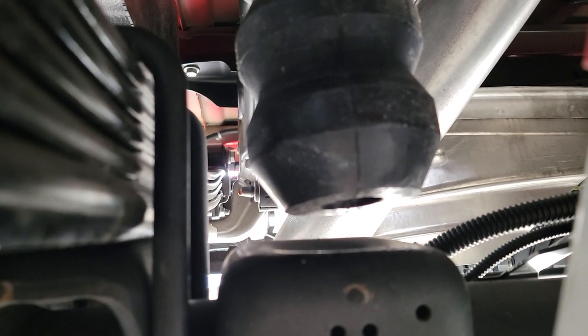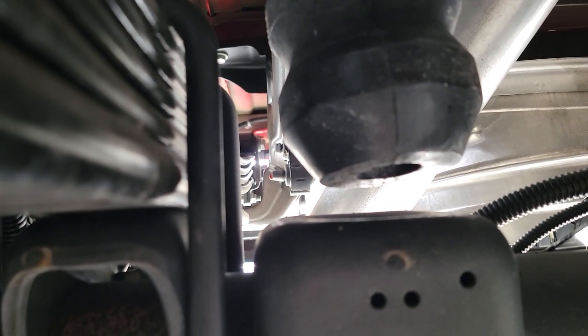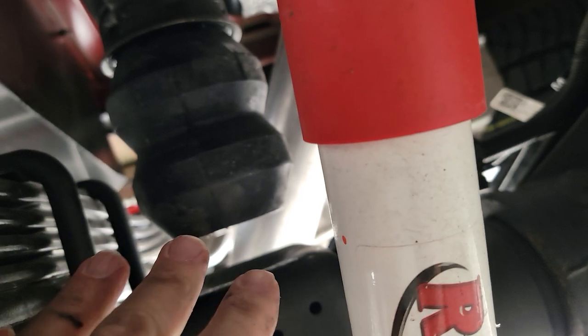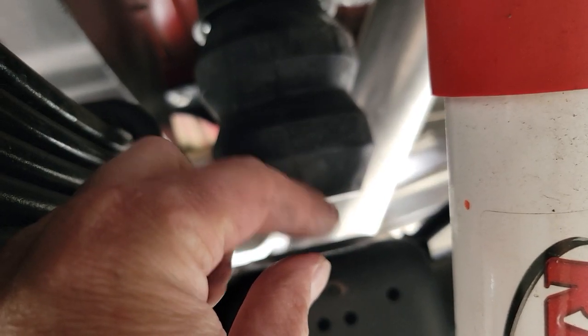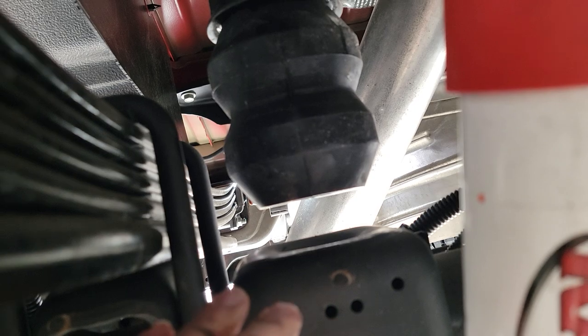If you're going Sumo Springs, you want black or blue — yellow is the extender or severe service. They are now installed. These are about $250 worth and they'll last forever with no maintenance. Once you start putting weight from a gooseneck or trailer it closes that gap and eventually it can touch, providing resistance back to help level the truck and reduce sway. This is a 15-20 minute install, maybe 30 if you've never done it. Head to your local Harbor Freight and buy a $9 pry bar — it'll pay for itself in this one install.